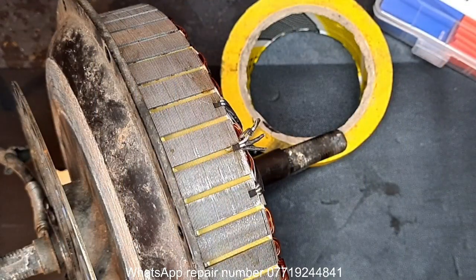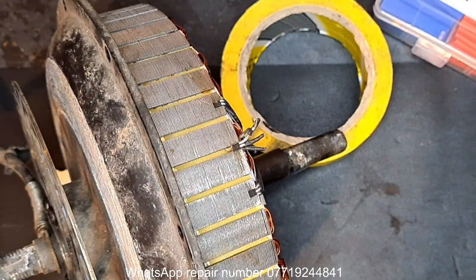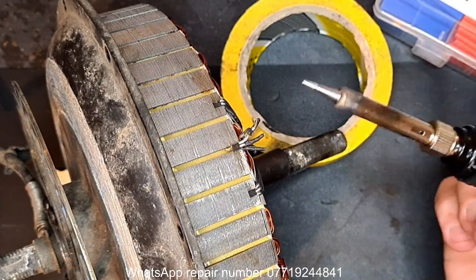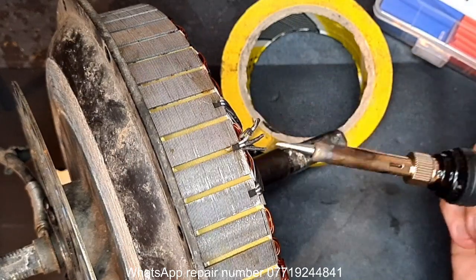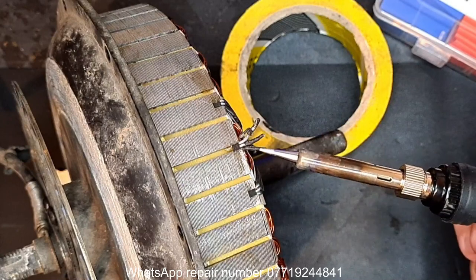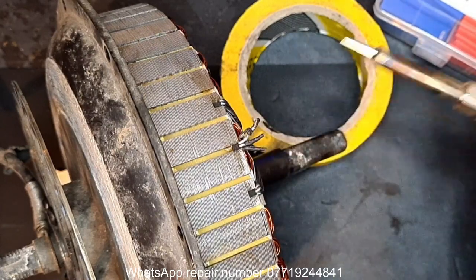Right, so that's pretty much where we're at. I have to get that rotated off camera in case anything started shaking. So let me use the tip of my soldering iron in a second. We've got one, two, three. We've cut the three legs on the faulty sensor. It was receiving 5 volts, tested through the line. Nothing was coming back when you rotated the motor.